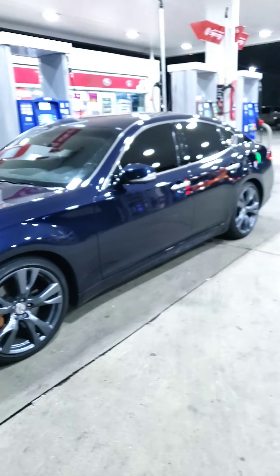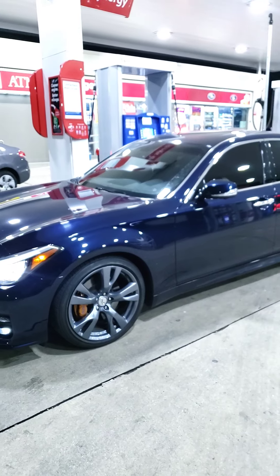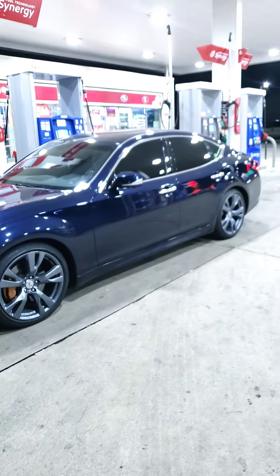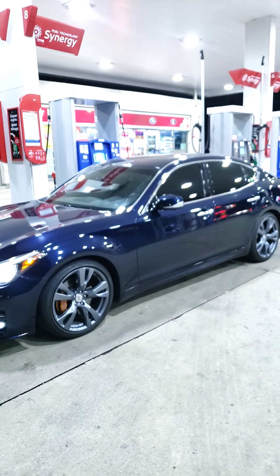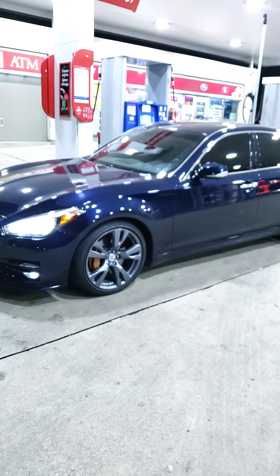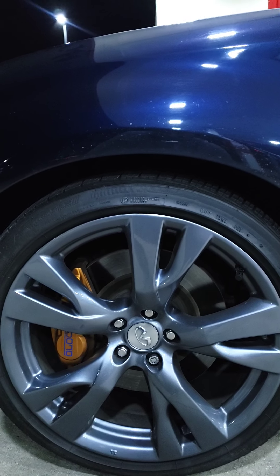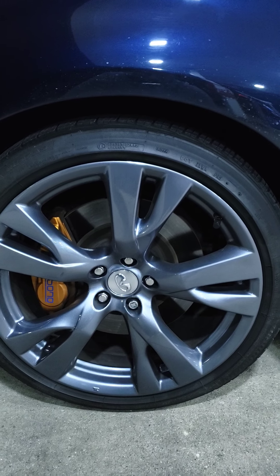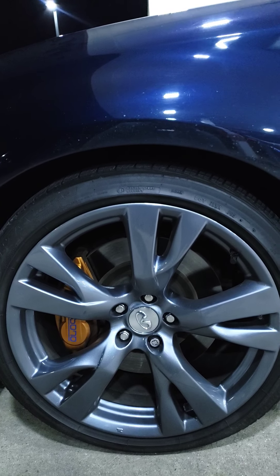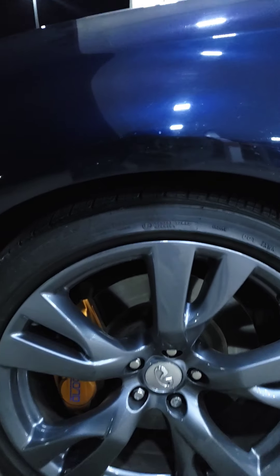I personally do not have airbags — I have RSR lowering springs. I got the RSRs because I thought that was going to be low enough, but I didn't realize how much wheel well we got on this car. Wheel well definitely has to do with tire size. Currently I'm running a 40-series tire on a 20 — these are 245/40/20s, standard tires, Bridgestone Potenzas. Pretty good, but as you notice with lowering...